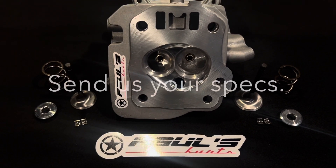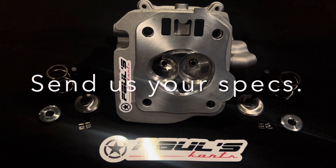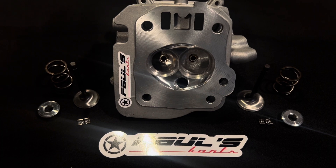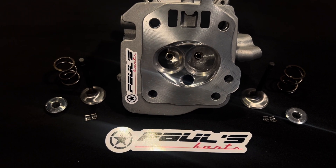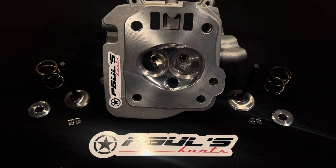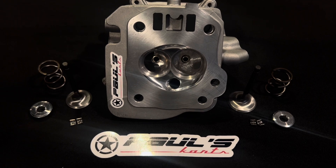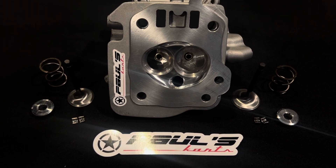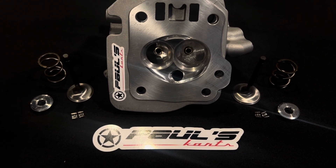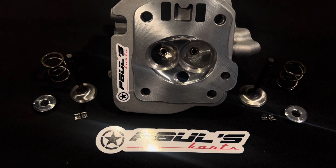On the website you can select 'Send Us Your Specs.' When you insert your bore, stroke, and engine type, there's a bunch of questions — vehicle type, vehicle weight, all kinds of questions. You fill all that out, and you enter your type of cam, so we'll know the bore and the stroke, which gives us the volume of the engine, and the cam gives us the RPM.